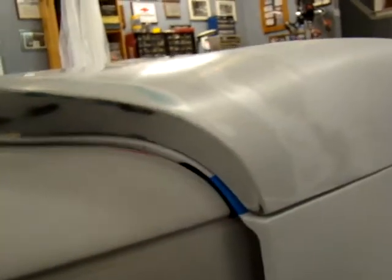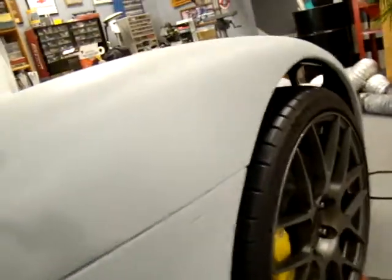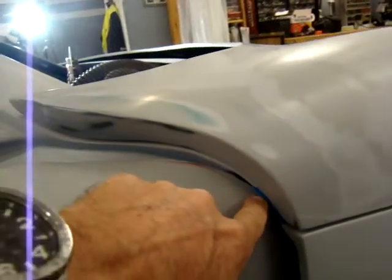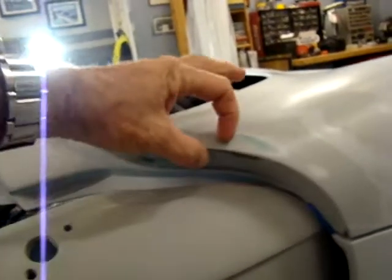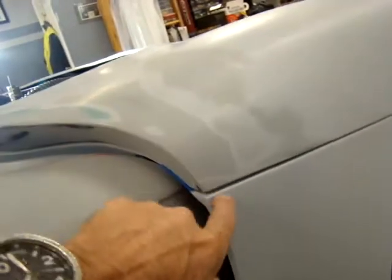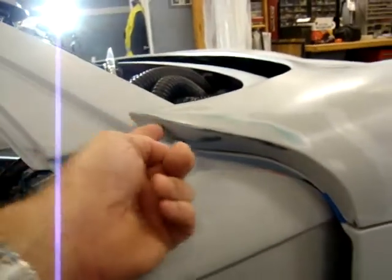And then the other thing I did, you'll see I have a little bit of adjustment still available on the body, but what I did, I'm going to set the camera down for just a second. And I just gave it a little tug, and I haven't tightened it down yet, but I wanted to show you where I reworked the corner here. So I closed this, so I added material. I was actually short about 1/2 inch, and this thing came all the way down to about here. And so I had to add this whole end onto this corner, and then I had to cap it off.